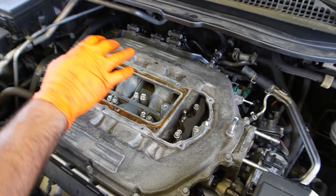Now it's time to install the throttle body back. I have the new throttle body gasket. Torque down the throttle body to 16 foot-pounds. Don't forget to plug in your throttle body cable. Now go ahead and install the intake.